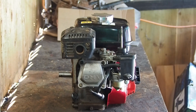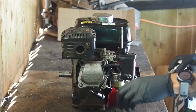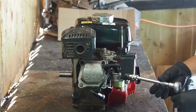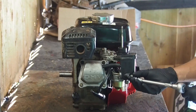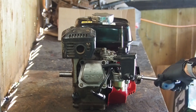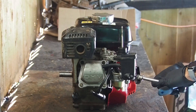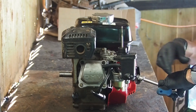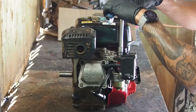It's quite funny because I rebuilt this off camera — I thought I'd just do it quickly. Actually, the only thing I didn't replace on this engine was the piston and the rings, because I did check them and the wear seemed all right. I started her up and I was like 'yes, happy days' — and then boom, it smoked. I left it running for a good 40 minutes to an hour and it just kept smoking.